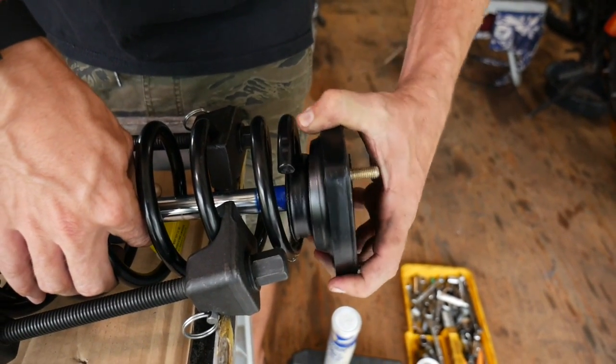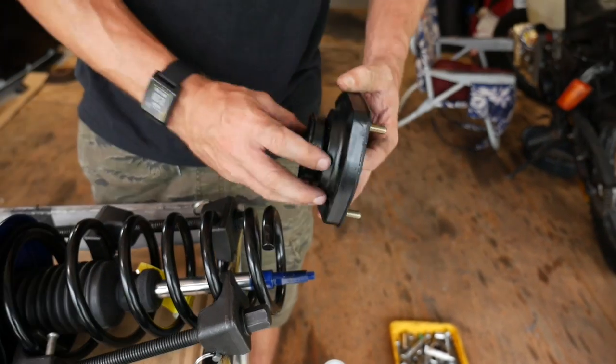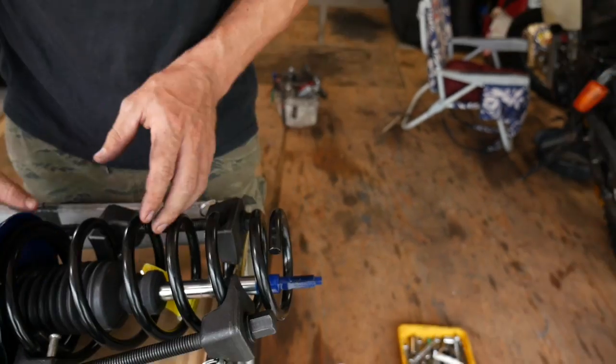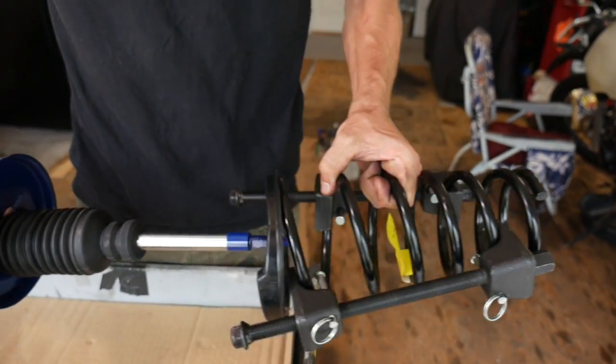This will have separated parts, so just make sure you don't lose any. There's a bushing in there. Keep in mind which direction stuff came off — it doesn't matter so much which way it spins, but the parts and their orientation are obviously important. Then you'll be able to just pull the spring right off. That's how you take the spring off of a McPherson strut safely.